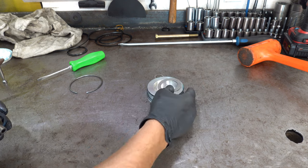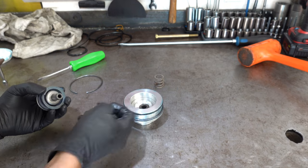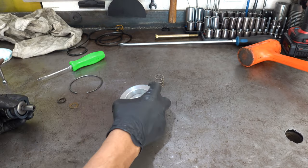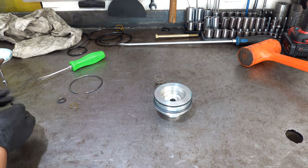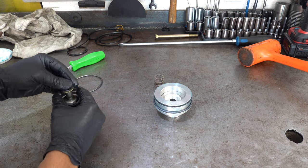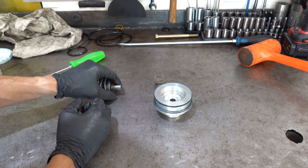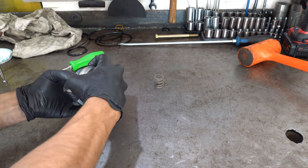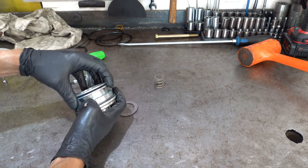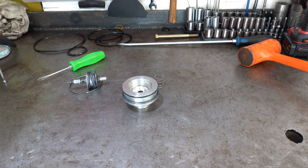All right, you protect the spacer. Oops. Then your shim pack. So I got the gold shim, the crush washer, and then we have the silver shim, which I don't know what I did with. I think I might have misplaced it back into the drawer. All right, let me go grab it. It's a 30 thousandths thick silver colored shim.